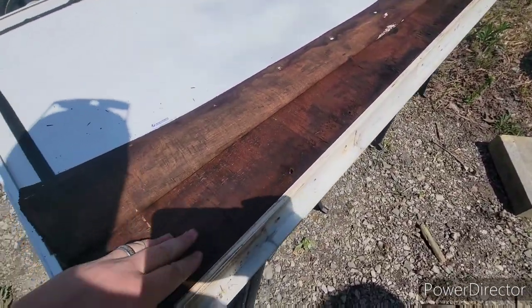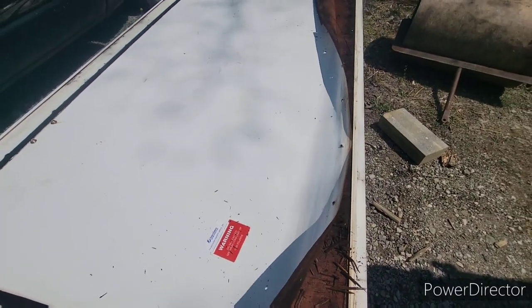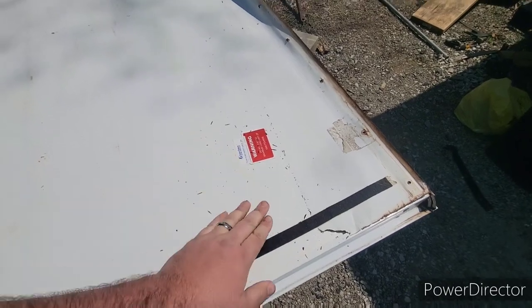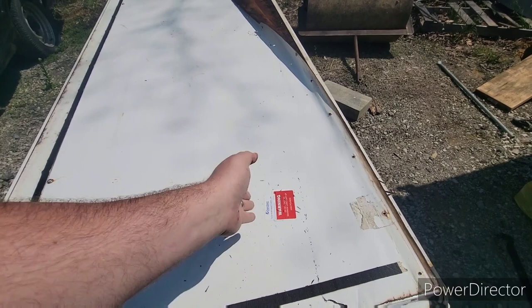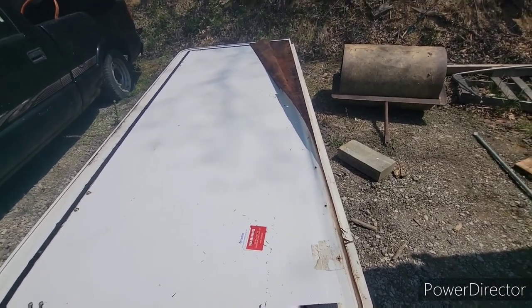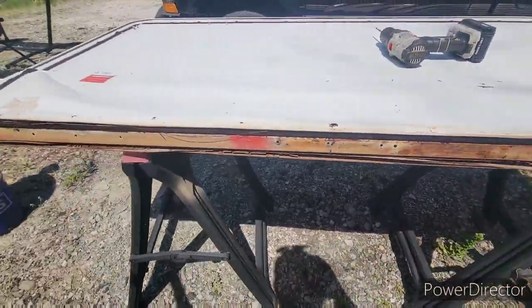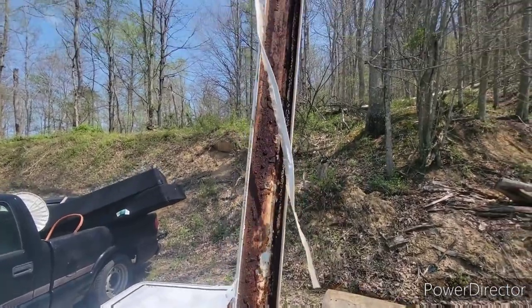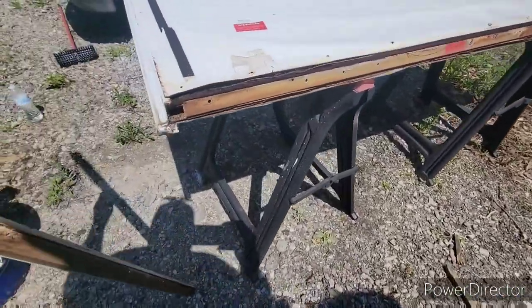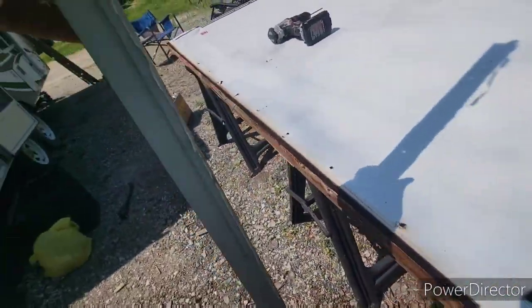It's just leaping with water, just peeling right up. Next step is I'm going to get a piece of wood for a straight edge, pull this back to find where the dry wood is, put that piece of wood across as a straight edge, take my oscillating tool and cut a straight edge across it to get all the rotted wood out of the way, and then start repairing. This is the bottom piece of trim off the bottom of the door — it's got a good bit of nastiness inside so I want to clean it out with a wire brush.